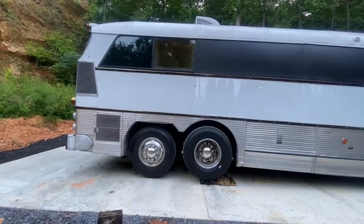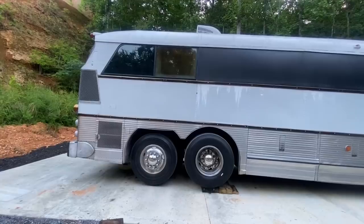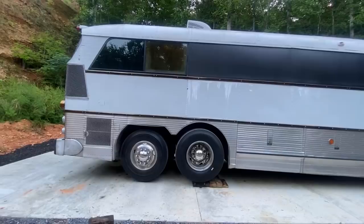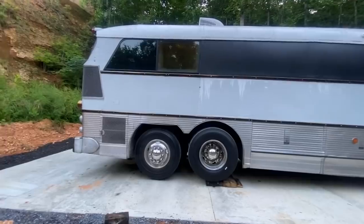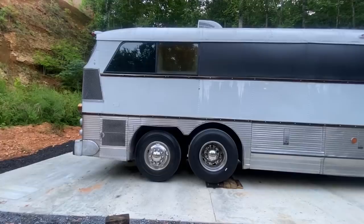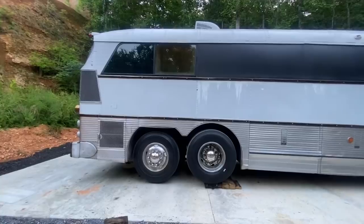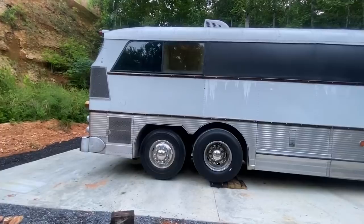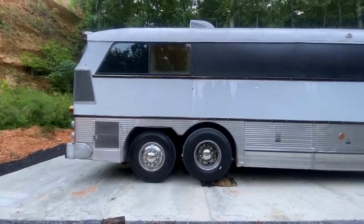Number two, the brakes — he wants them readjusted. At 5,000 miles, these don't have auto slack adjusters, so you need to keep on top of them. 5,000 miles of driving is quite a bit and they're definitely out of adjustment. The tags were really bad, which I knew they would be, because they had been inoperable for seven years. Somebody had disconnected the system and just left it disconnected, and he did not know that. He reached out to the previous owner and found out how long it had been. The drums had significant rust on the inside of them.